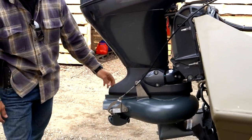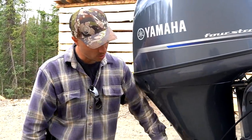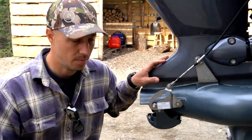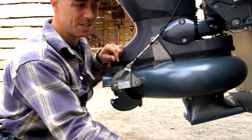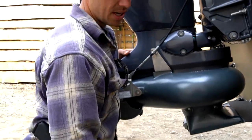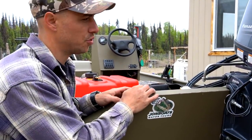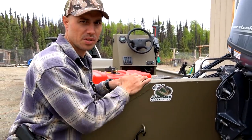It has a jet unit on there. This motor started out as a 90-horsepower, but when they take the prop off and put a jet on, it lowers the horsepower down, so we're sitting at 65 horsepower. You can run very shallow water in this boat — about three inches if you're going fast. We also had automatic adjustable trim tabs put on, which help you get on plane faster and go in a little more shallow water. The motor is a four-stroke — our old one was a two-stroke — so it's a lot more fuel efficient, a lot more power, and it's a four-cylinder motor.